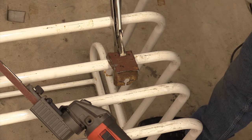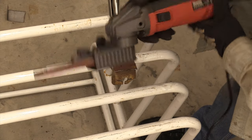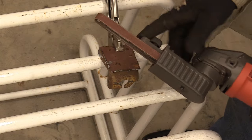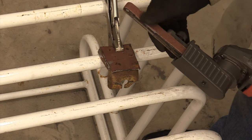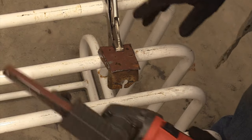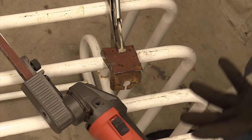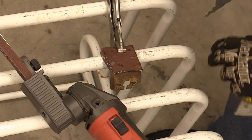I'm going to put my hearing protection on because this thing can get kind of screechy. This is a band file belt sander - a really nice little tool. One of my viewers wrote in and told me I should try doing this for cutting spot welds. The only thing I've had a complaint about is the longevity on the actual sandpaper, because it's such a small narrow area it uses up pretty quick. I'll also say - I don't know about later Torinos and Fairlanes and Falcons - but in '66 at least on this one, these spot welds are huge compared to what I normally see on Mustangs and Falcons. I don't know if the spot welder was just on its way out making these big welds, or they wanted something a little more meaty for the Fairlane cars.